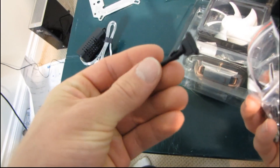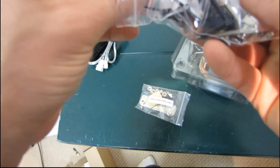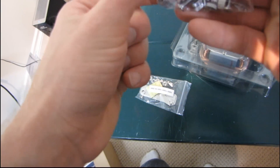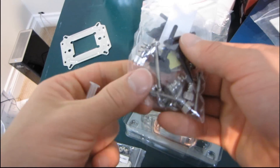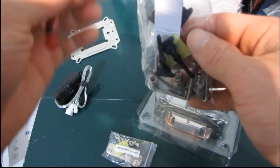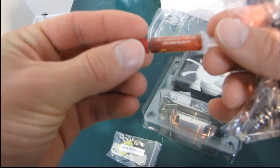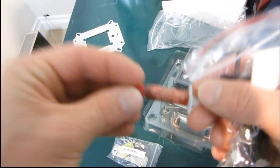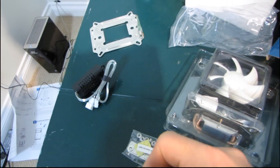I love that all of the mounting hardware is made out of solid metal pieces — there isn't a single plastic piece of mounting hardware in this entire kit. We've got rubber grommets to mount the fan for noiseless fan mounting, and that's it for plastic. Other than that, we have bolt-through and thumb screws with spring mounting — things I really like to see, with no plastic nonsense. We've also got some included Silent X brand thermal compound with greater than 30% silver content by volume — a silver-based thermal compound.